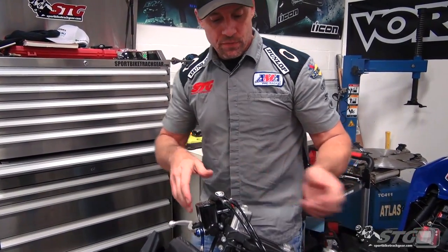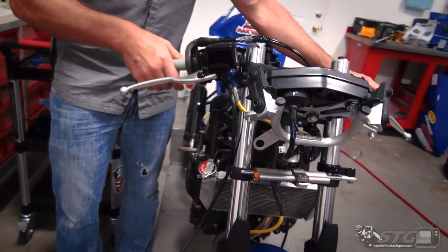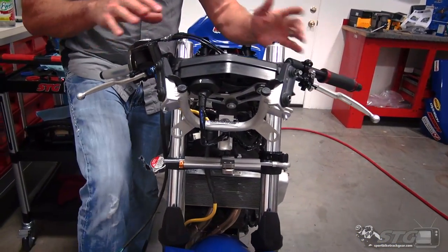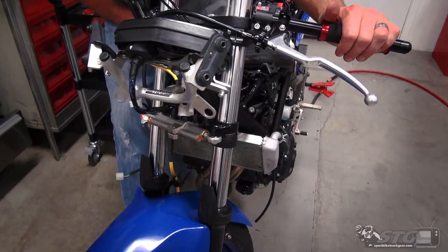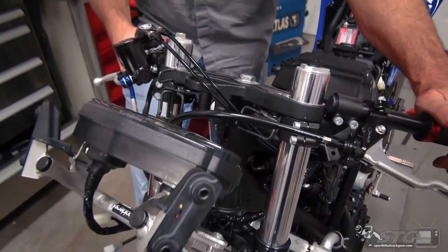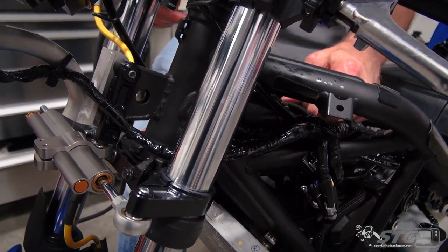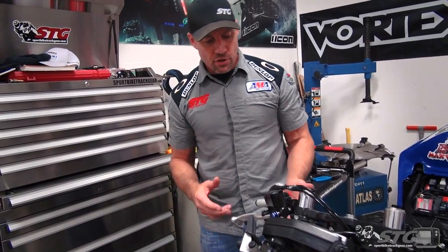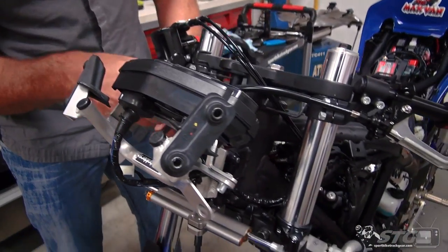I love the quality of the cables. If you've been in motorcycling for any period of time, you know Motion Pro and cables - those two names really go together, great history. Clean off some of the cable lube. This is not final - this will be fine-tuned for sure. Before I go any further, let's just sweep the bars. Through the whole sweep, we're checking that snapback, making sure we don't feel any binding, and making sure we don't see any cable conflicts - any cable banging against something and creating issues.